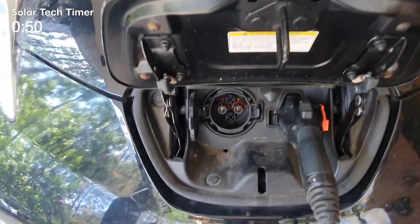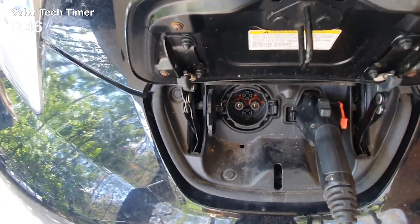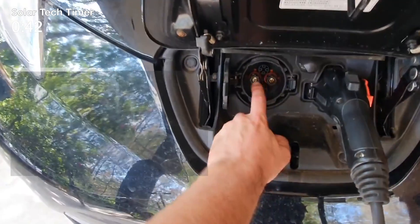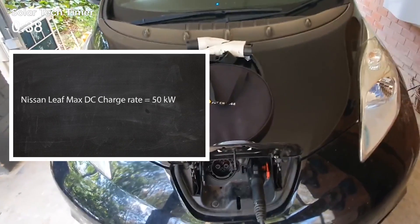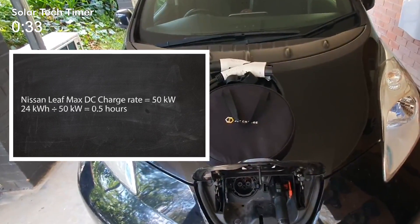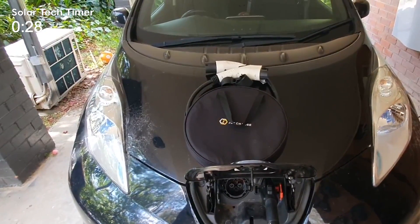You can see down in the front of the car — the right-hand side is the AC connector. It's quite small compared to the big fat DC charger on the left. That's because that DC charger can do 50 kilowatts DC. So rather than taking 10 hours to completely recharge the battery, that recharges this car from flat in just over half an hour. You don't want to do that too often on a little battery, because it'll start to get hot and wear out.